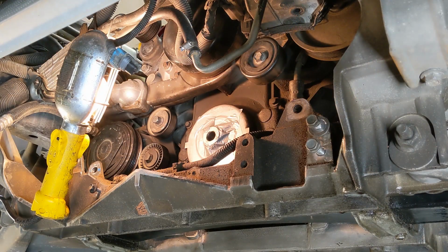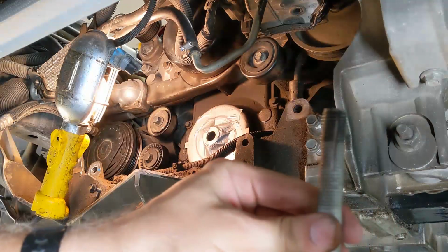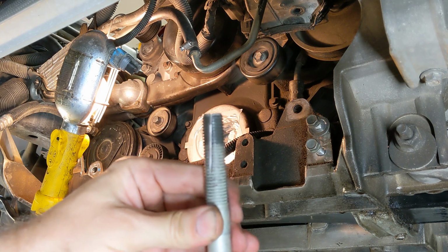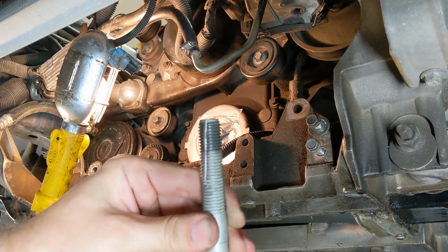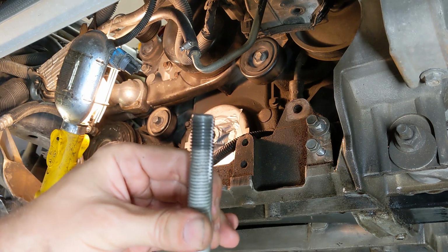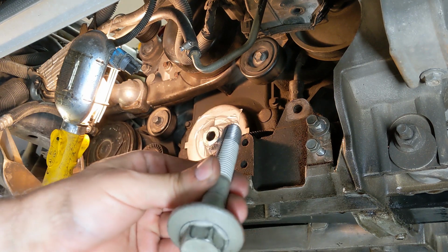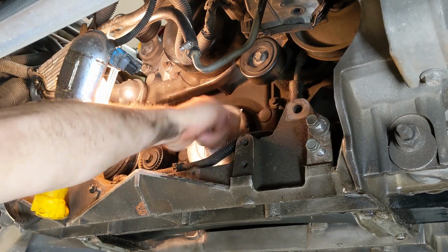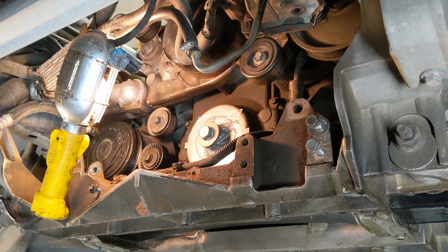Okay guys, I've cleaned out the threads inside the crank with electric spray, which is essentially a solvent, and compressed air. I did that twice. I cleaned the bolt as well that we ran through there, the homemade chaser. It had little chunks of metal in the grooves and the grease, which is exactly where it's supposed to go. And here's the $1 million test. And the threads look really good, by the way. Beautiful. I couldn't be more happy.